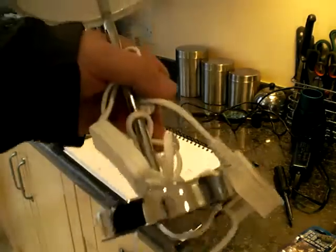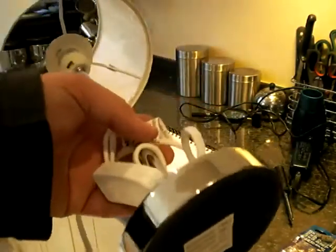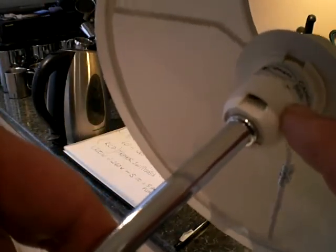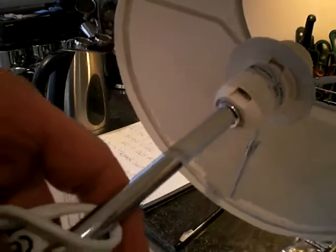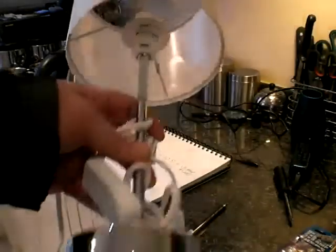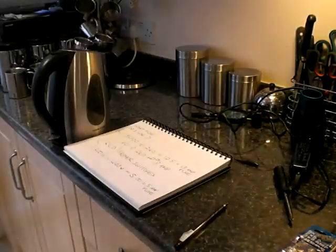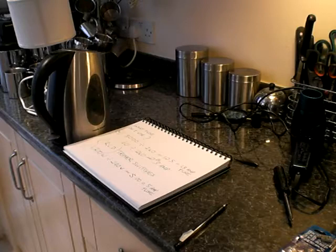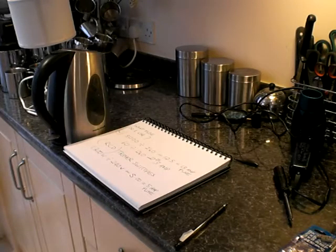But I'm also interested in putting a fuse in this little lamp. I want to know the wattage again — what is the wattage of this lamp? Well on the bottom here we've got the sticker again, but it doesn't tell me the wattage, and that irritates me because I think it should, because that helps us determine the fuse rating that we put in our plug. Anyway, up inside here it says 60 watts, and that's the bulb I'm going to use in this appliance. It's got nothing that I can turn up, so the maximum is going to be 60 watts for that appliance because it's just a bulb.